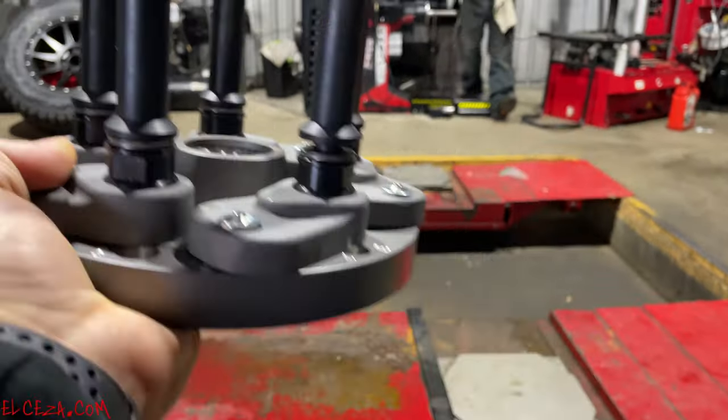That quarter of an ounce is going to balance it. Is this rim still going to have a problem? I've only got 8 pounds of road force on this rim. So what it saw was the potential that maybe somebody has curb checked this inside or outside, and it saw an imperfection in the rim and it's just letting you know, hey, I see something that isn't normal here. So I can still balance this and get 8 pounds of road force out of it. That rim will still roll smooth.